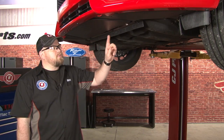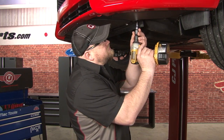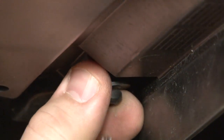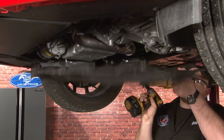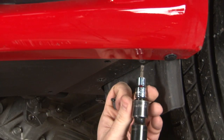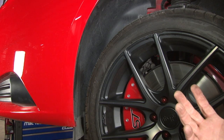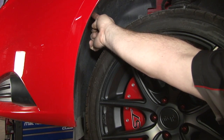To start removing the bumper cover underneath, we'll have to start with this air deflector, followed by the belly pan. All are attached by Torx head screws. Next, remove the seven screws that hold the lower fascia to the body. Next, there are three screws located in the wheel well area on both sides. One's down at the bottom here. The other one's kind of hidden behind the bumper cover here. The third one is right inside there.